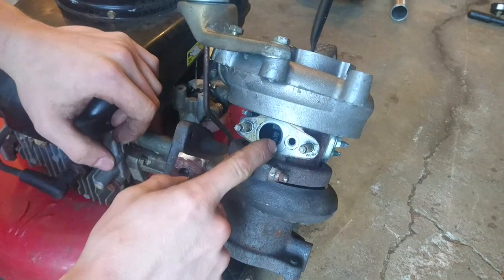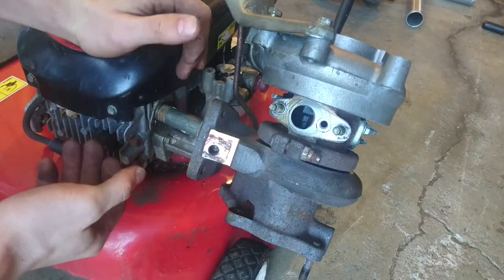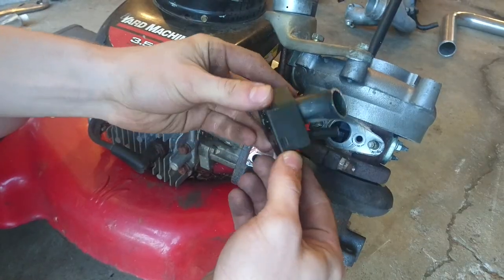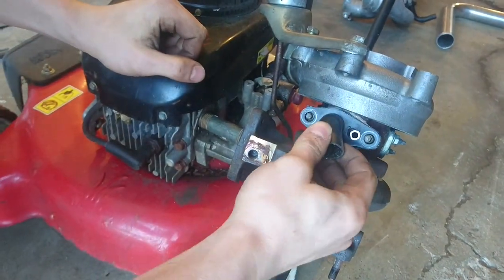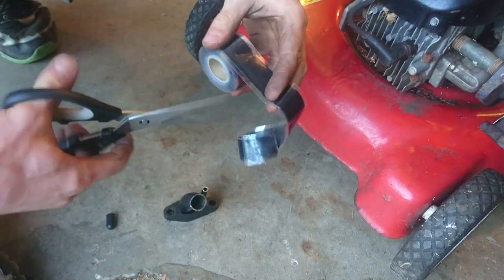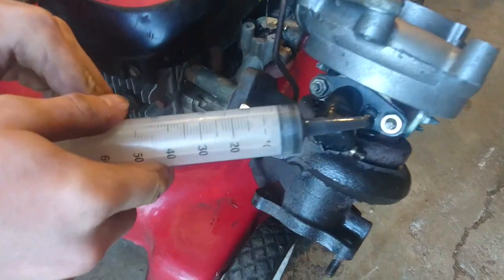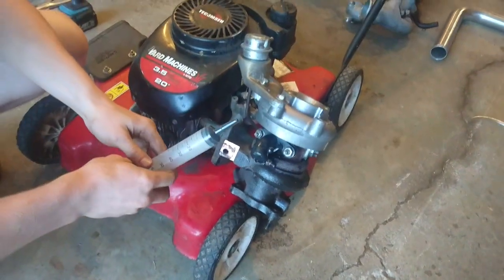This here is the oil feed and drain port for the stock CT26 turbochargers, but because our lawnmower doesn't have any high pressure oil ports, we're going to fill it up and block it off. Off the stock oil feed/drain line setup I cut this piece which bolts on, giving us an oil feed and oil drain port. I've got some self-amalgamating plumbing tape, so I'm going to wrap it around the oil drain port, fill the turbo with oil using a syringe, and cap it off. We did spill quite a bit, so it might smoke.